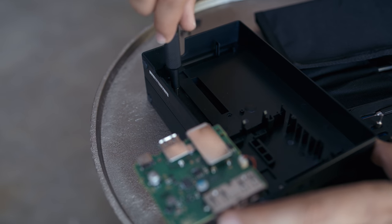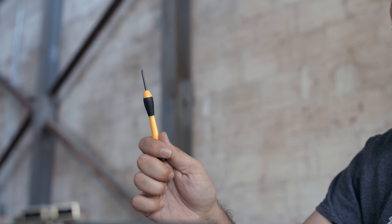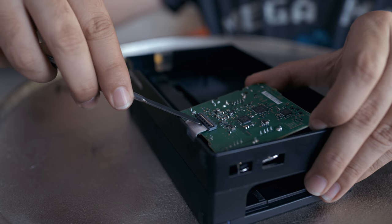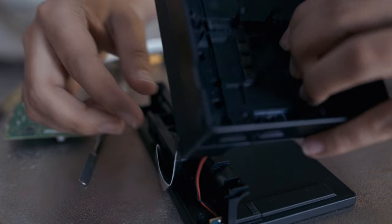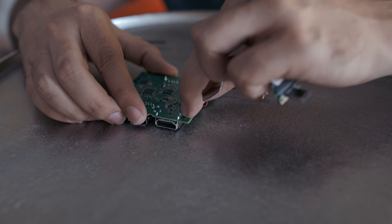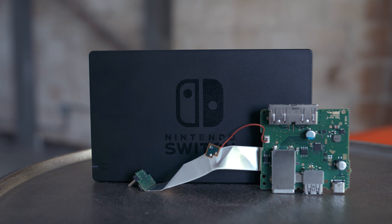At first glance, you might think you can use any small Phillips head screwdriver to do this, but some of the screws are actually recessed really deep, so you're gonna have to make sure you have one that also has the reach to get to them. After taking those out, we do need to temporarily unplug the power indicator light, which just takes a little pressure to pull out, while the ribbon cable is gonna need a little more finesse, and is made much easier using a small prying tool. With the board disconnected and all the screws gone, you can easily remove that second layer, re-hook everything up, and we have freed the insides of the Switch dock from its surprisingly large shell.